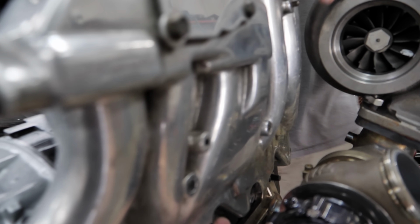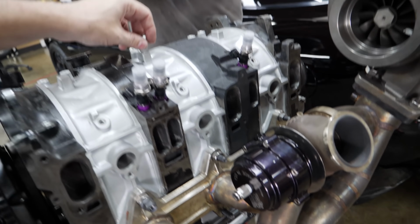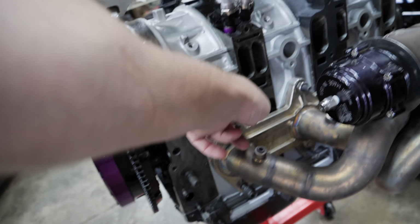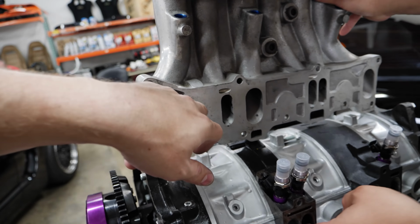Yeah. We're gonna double team this third hole. Oh yeah. Oh, there we go. And there you see the problem. Primary holes, secondary, and rotors right in there. Those are the semi-peripheral holes that we now need to make runners for.